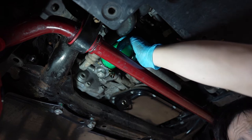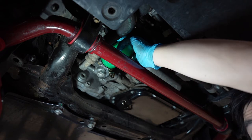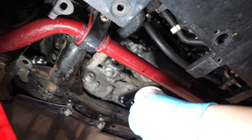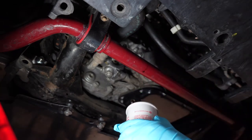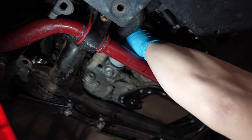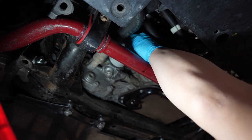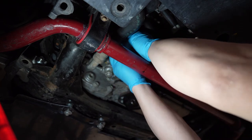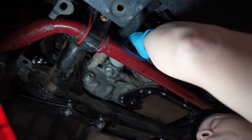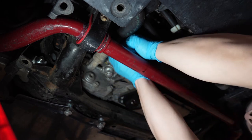I would never leave my car over 20,000 kilometers — that's just crazy. Leave a comment below, what do you guys think? Anyway, if it's under warranty and they say 20,000, use 20,000. I'm gonna go ahead and throw on the oil filter, but make sure you prime or lube the o-ring around the filter before you put it back on. Also, while the oil filter is off, take the opportunity to clean around the oil filter plug and the oil filter hole — make sure it's all nice and clean. Once you get it on nice and tight with your hands, just give it about a quarter twist.